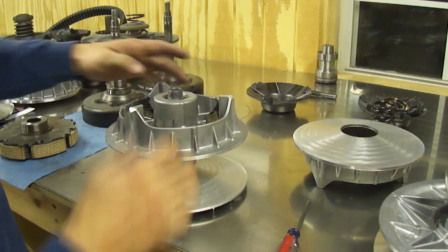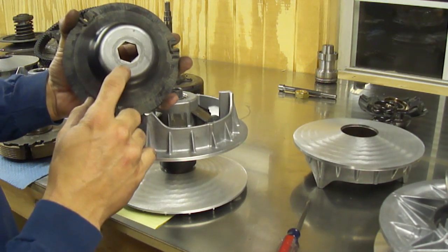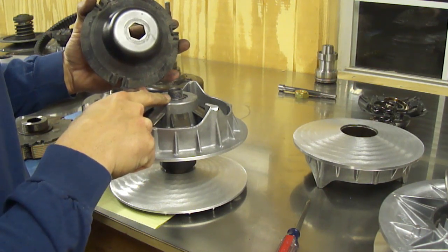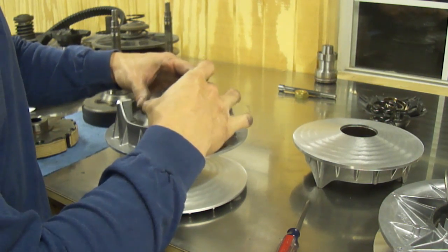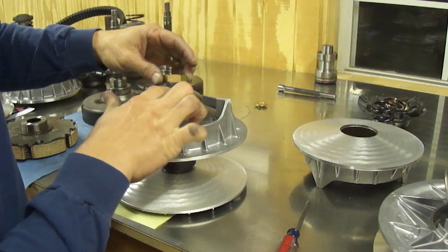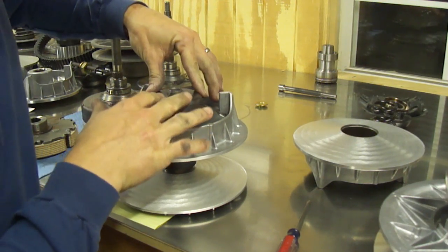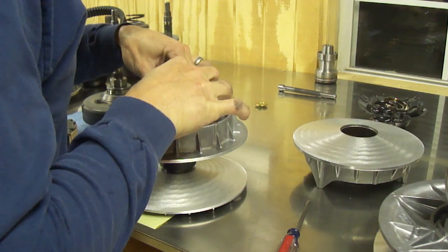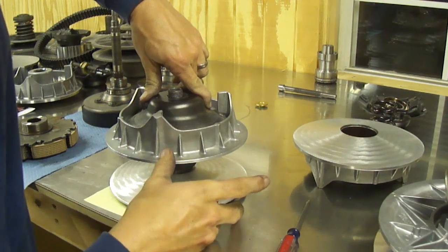When you put this cover on, be sure this cover has a hex in it. Always remember this hex has to lock together with the hex on the shaft to hold the clutch together. If you do not install this clutch correctly, it will cause some negative effects. Once the clutch is together, you have your nut that goes on the outer half — this shaft is threaded and the nut will thread down. You push the clutch together with a little bit of spring tension, and you twist the clutch to find where it locks. Now the outer half of the clutch cannot spin independently of the inner half — they are locked together.